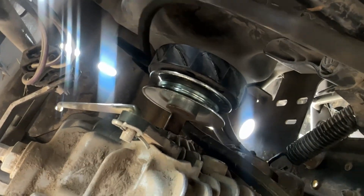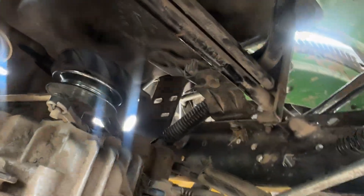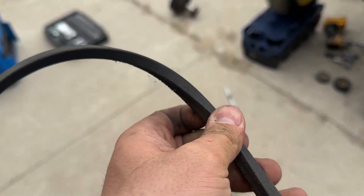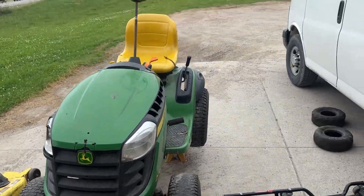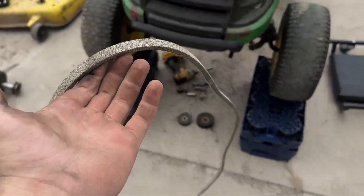Now you've got that keeper out, you can wrap it around the fan and pull it out. As you can tell, this belt is a lot bigger than the new belt. The new belt is in the description — it's a Kevlar reinforced belt and it will stop this stretchiness from happening. Because with these normal belts over time, they'll stretch and actually start to tear. So this is garbage, and we're going to go put the new one on now following the exact same steps.